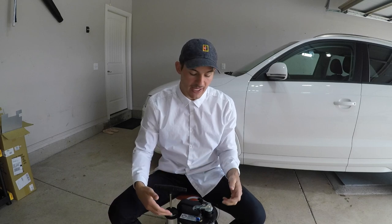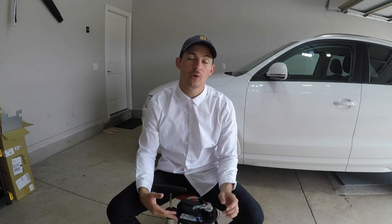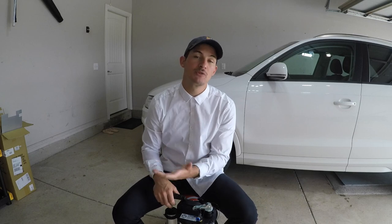So it has a hard time flowing, but there's so much pressure that it ends up trying to leave somewhere, this pressure, that it hurts the seal around the Mityvac. And with time, if you keep doing that, it will corrupt the seal and the contents that you've tried to evacuate will end up all over your garage floor. So get the motor oil warm or get whatever you're gonna try to suction out warm, pump it a few times, be patient, go eat a bowl of cereal, do something, come back and you should be ready to roll.